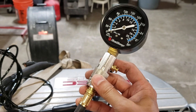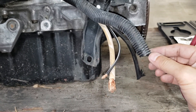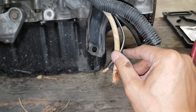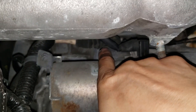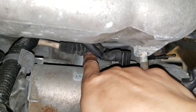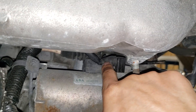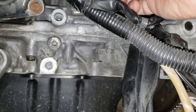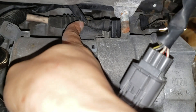It's kind of hard to do with one hand, but you just slide this back, it pops in, and the gauge is in. With this engine being pulled, I know the wires connected here go to the starter. The thick white one goes to the starter — you can trace it right in there. Here is the starter switch cable, which is the black-and-white stripe wire. You can follow it down and slide the sleeve over to make sure it's the correct cable.